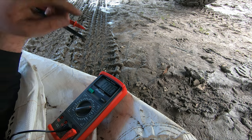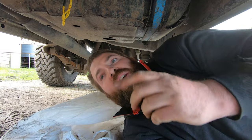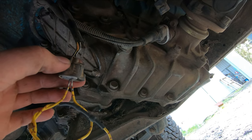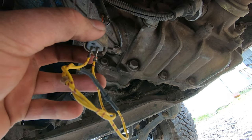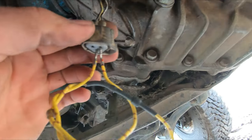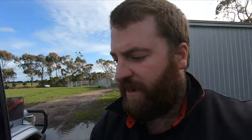So it's got to be on the sender unit side. We've tested for battery voltage — 12 volts, five volt reference signal, and earth — we've got all three. So we know the front half of the wiring is fine. One more thing we can test: jump a wire to see whether the gauge itself works. What I've done is jumped the five volt reference wire and the earth wire together — that's the yellow with the black tracer and the white with the black tracer. Now if we go look at the gauge, it should read full. There we go — she's full! By jumping those two wires together, we've tricked it into thinking it's got a full tank.